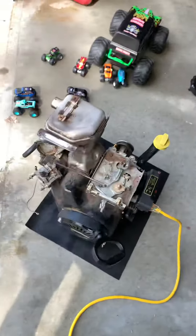See, this is why I like the older Briggs and Stratton motors. They never die. This is a perfect case in point. This thing completely locked up. I had to pry on the flywheel hard to get it broke free. But once it broke free, it spun real freely and I don't even have to fight it to get it started. It just works.